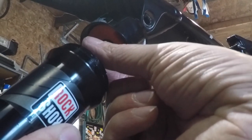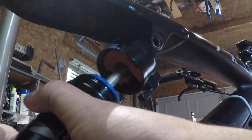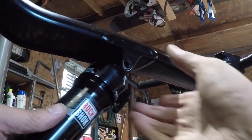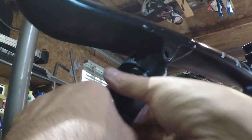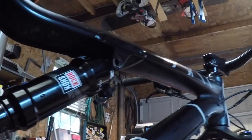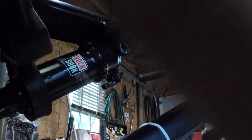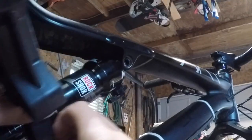Take your volume spacer, slide it over the shaft, pop it into place and you're good to go. Let the can slide back up and replace the washers. We're going to take our strap wrench and tighten that back up — you can buy a strap wrench at your local hardware store. Just snug it; definitely don't want to over-tighten that.